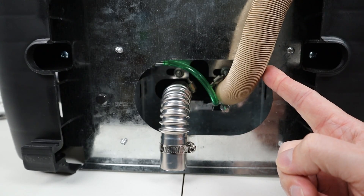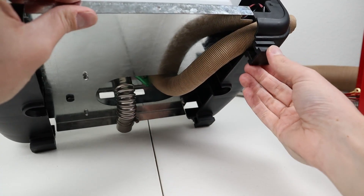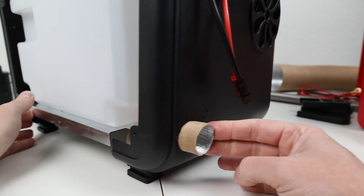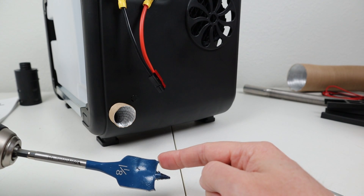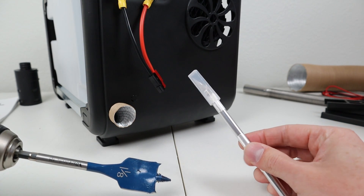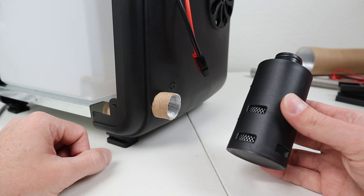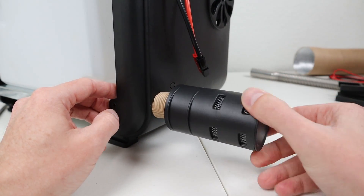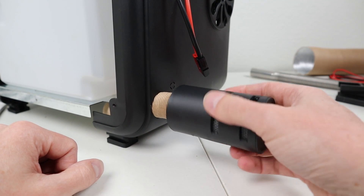The second mod is how I routed this intake hose. With the exhaust pipe connected going out that way, I routed the air intake underneath — it fits perfectly inside that gap without any cuts. The only modification was on the front where I drilled a hole with a 1 and 1/8 inch spade bit, then routed it through and used an X-Acto knife to trim the final pieces. I also cut off the excess hose with the X-Acto knife. The air intake filter that keeps bugs out has a threaded end, so you can just screw it on. Whenever I'm using it I leave the filter on, and when I'm done I just unscrew it and take it off.